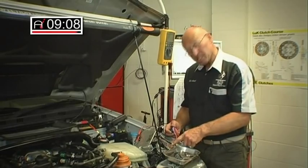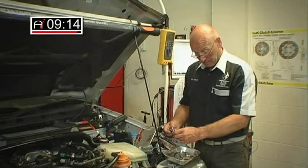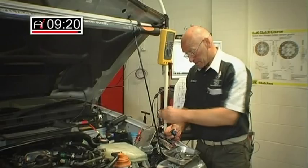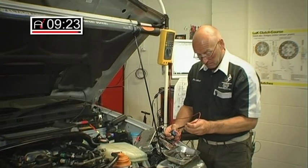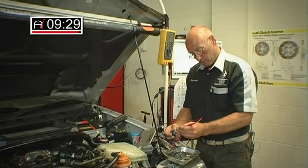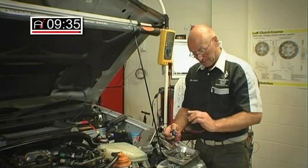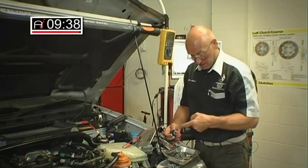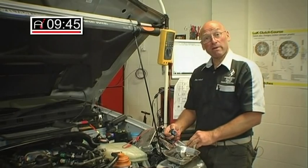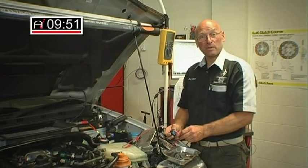We've cut back some of the taping on the loom for two reasons: identifying the wires by colour, and so we can actually manoeuvre the cables into a position where the probe can be inserted carefully alongside the cable down to the back of the pin. The critical components are very fine, strong but sharp, durable needles with direct access into the back of the cables. And of course the schematics of the wiring are important so we can identify the alphanumeric coding of the socket. That concludes the how-to workshop, and I hope to see you in the next feature.